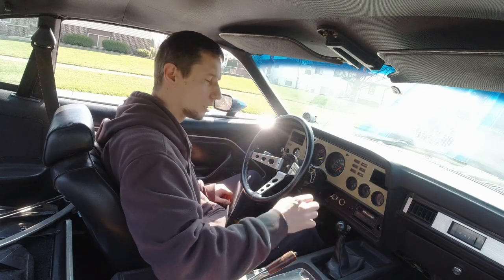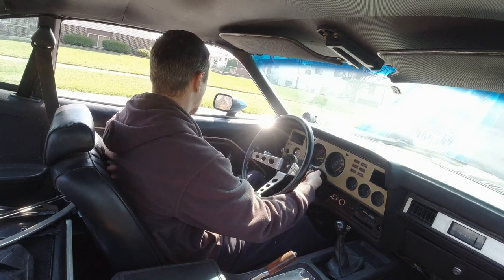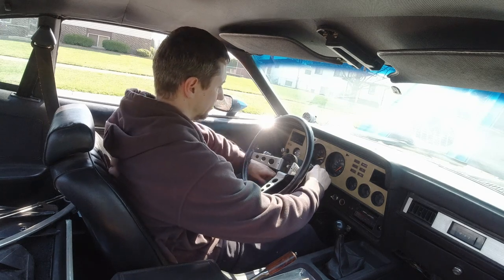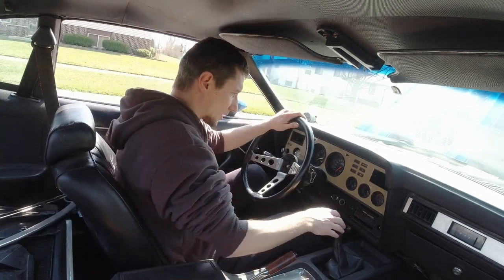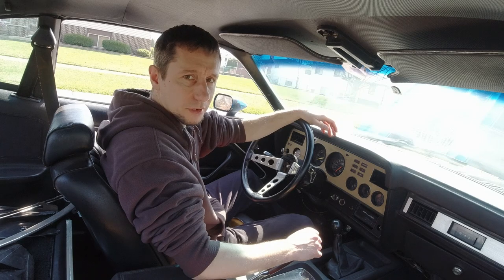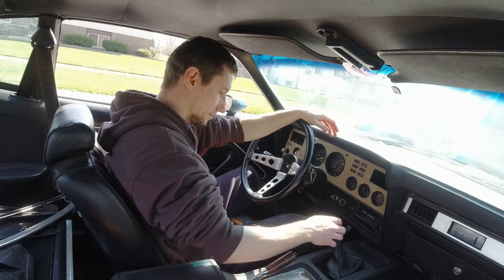Apparently we had no fuel — a little bit of fuel in the filter — so we may have a fuel delivery issue on our hands. Let's try this again. No — damn it. Alright, one last time. The problem is the battery is dead, and the booster only works for a few seconds then automatically shuts off, so you can't crank it for too long. I'm trying to build up the fuel in the filter, but to do that I need to crank it a little bit longer.